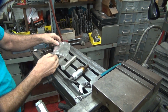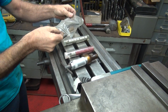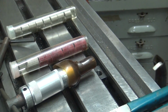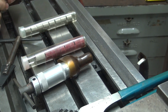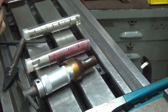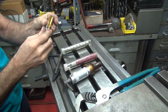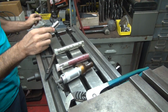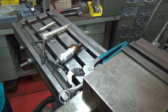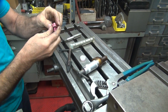What are those? It would be helicoils. What's the difference of the red ones? Locking. Well, wouldn't it just make sense to always use the locking ones? No. And why is that? In case you have to remove it? You might pull the helicoil out too. I would expect the locking one would stay in better. Not for holding in, it's for holding your bolt in.